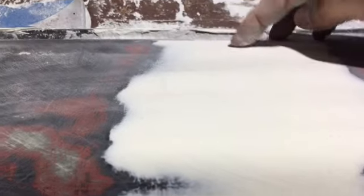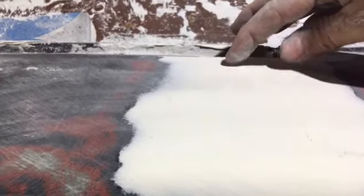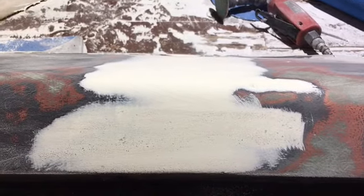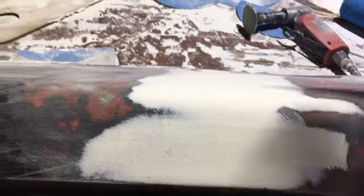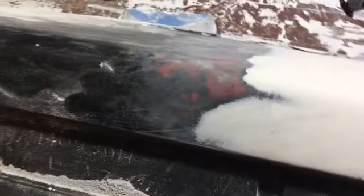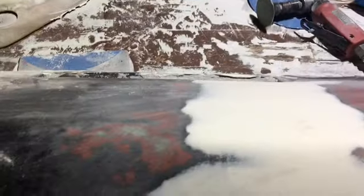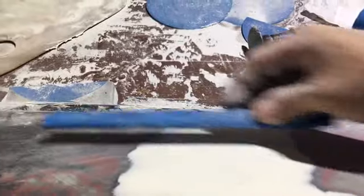I used this grinder, and I ground out the crack, and I found a good solid surface. I found good material. I went back, and I put the spray foam on it, let it set up and cure overnight, had to wait 8 hours. And then you saw me a while ago when I had some Bondo right here, I had just extra filler, so I put it on this crack, and I filled it. And then I took my time, and I knocked down the high spots with the DA, and then I went from there to a paint stick, and I sanded it. Remember, I did the 15 degrees, crossed my pattern, and then I hand sanded and rolled it over.